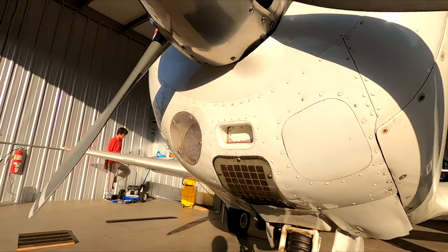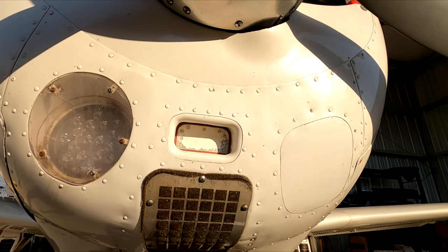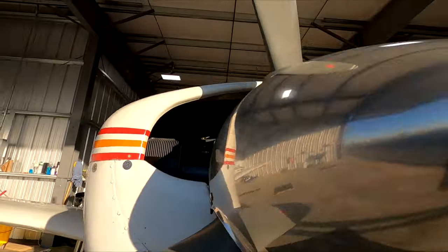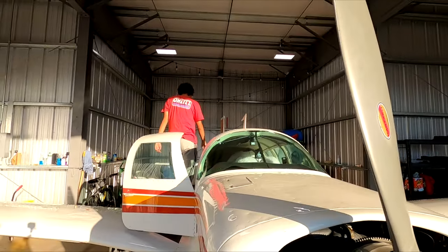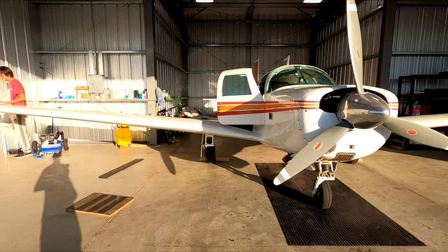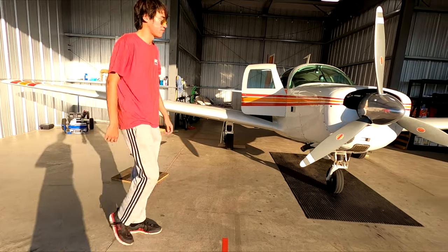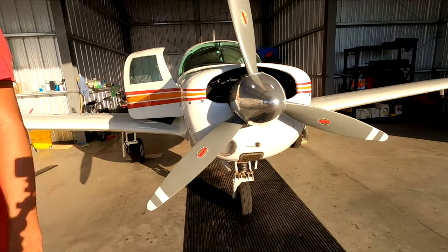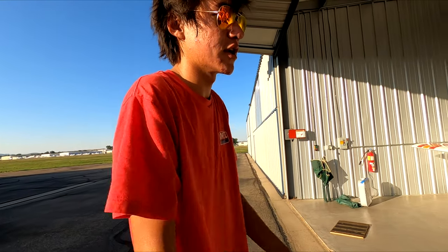And you can watch that slit. And that's going to totally open up. Yeah, so you can see how it opened? Yes. So pretty much what that does, like I said, you'll see a trend here with Mooney. It just completely bypasses the air filter. So the air that the engine's burning, instead of coming from the air filter, is just coming through this hole.